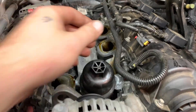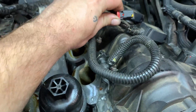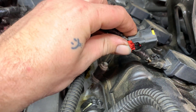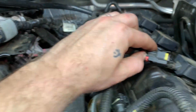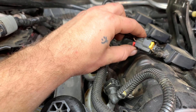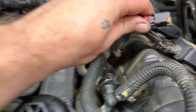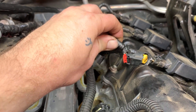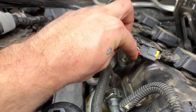You've got to unplug all the fuel injectors as well as the fuel line. These have a red lock on them — it goes in about this much and sits flush with the black. All it does is slide outward. Those are the locks, and once you plug it back in, you can slide that lock back down in place.